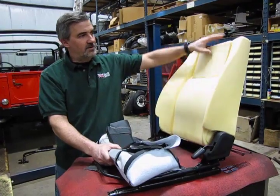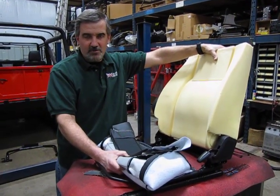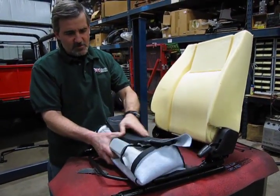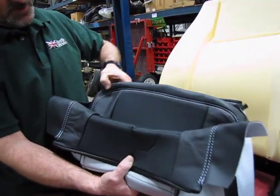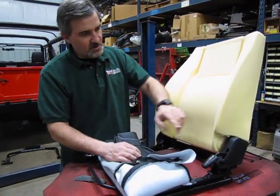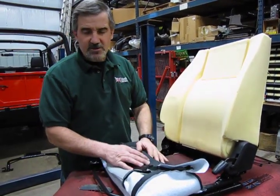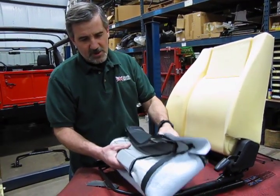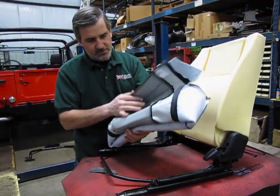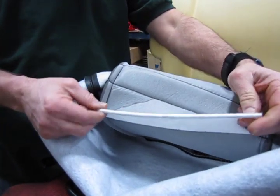Our glue is set and the foam is on the back — this will hold it in place. Once we put the cover on there, that's going to lock the foam in pretty well. We've taken the cover and turned it inside itself about three quarters of the way up. On the replacement, you have piping that runs all the way around the front of the seat. The key to getting a good-looking seat is to have the piping line up with the outer edge of the seat. There was a flap of fabric with three small hooks — the replacement fabric has no hooks; instead we'll use three long wire ties that come with the kit.